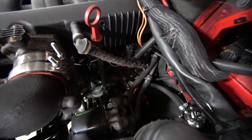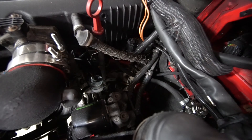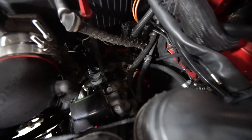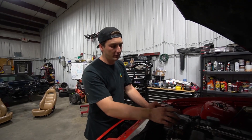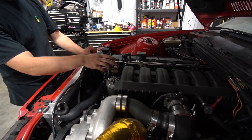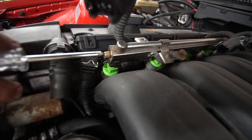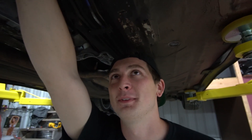I'm about to get sprayed in the face. I don't see anything — no fuel pressure. I realize there's a bleeder valve — actually a Schrader valve — on the E36 fuel rail right here. I'm gonna press it. We don't have fuel pressure, that means something's wrong. Look, it's a Schrader valve on a damn fuel rail — RJ had never seen that before. Honestly, just this task alone makes me so happy I spent the money on a lift. Trying to mess with fuel lines on the ground on my back was literally miserable.